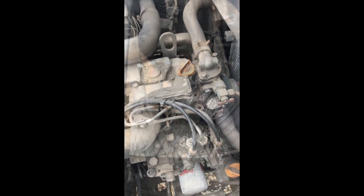Next, you got the oil filter and the fuel filter. We'll drop the oil — the oil plug is right there. All you gotta do is unbolt that, drop the oil, and once that's all done, fasten it back up and change out these filters.